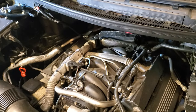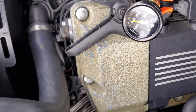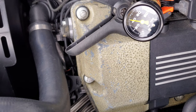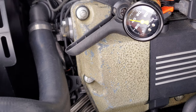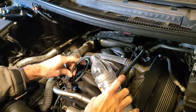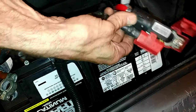After replacing the fuel filter I still had performance issues, so I checked the fuel pressure at the rail. With the engine running it was just below 40 psi, and with a slight rev it dropped into the 30s — well below the 50 psi needed to run these engines correctly. Note that when you turn the engine off there's still pressure in the fuel system, and you'll never get the connectors off the fuel pump with pressure in the system. To relieve it, use a standard inflator — just put it in a bottle and plug it onto the rail. Also disconnect the battery: it's safer and reduces the chance of confusing the ECU while you're replacing the pump.